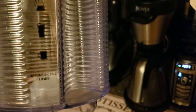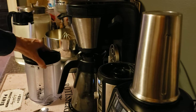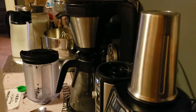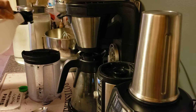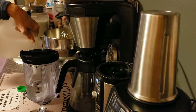On the carafe, the question is how do you clean it? Right where the travel mug size line is, you fill up with straight white distilled vinegar. You only want to go to the travel mug size line. Just untwist it like I told you, dump your water out, and fill this with some white distilled vinegar — straight to the line.